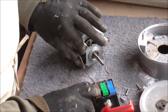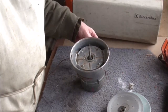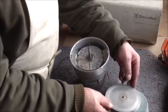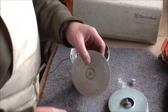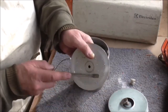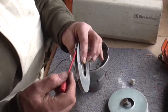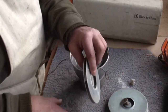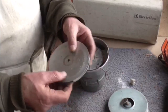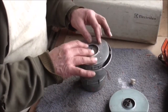Well, it's not too bad actually - well worth doing that. Now we've got to put the fans on, noting the order in which they came off. You've got your little bush there that goes on first, then the washer, then the fan. It's a good idea with fans to just hold the fan and give it a tap - you can see little bits of dirt flying out. Tap them carefully inside the fan around here - you do get a lot of dirt caught up in there. Most of it will come out with a tap. The point is, if you leave it in, it can sometimes upset the balance of the fans so they'll be noisy.